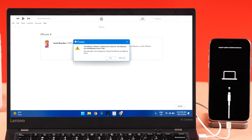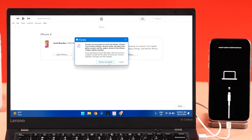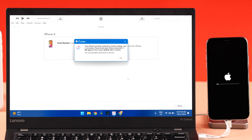If somehow this process fails, or even if updating your iPhone's screen is still not working, on iTunes you'll have to go to the Restore iPhone option, and then go to Restore and Update. This will erase all data on your iPhone, unless it's backed up on iCloud. Because at this point, you don't have much of a choice. Then just wait for the factory reset process to complete.